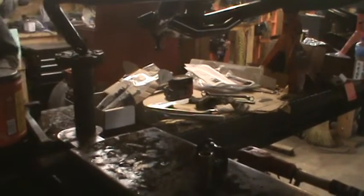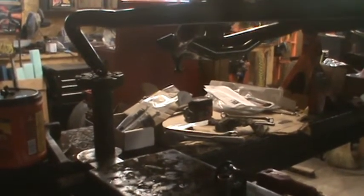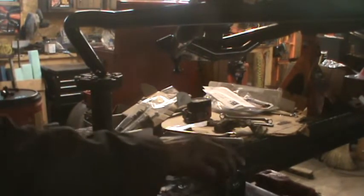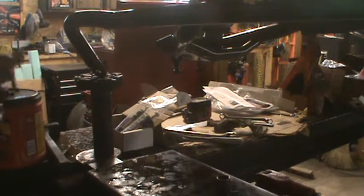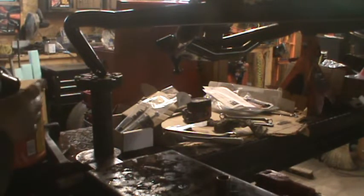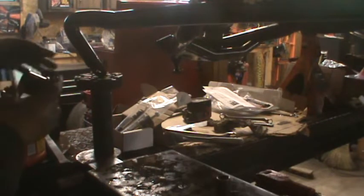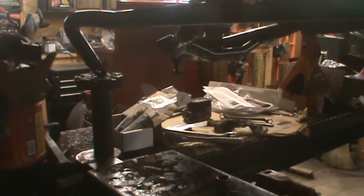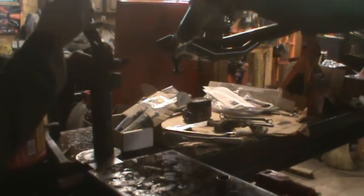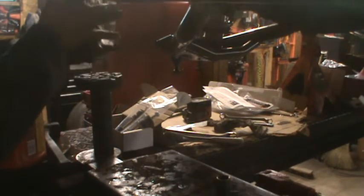So because I have help, I got on a roll and started to install the sway bar with that video on it. So I got one side up a little bit. Slip the rubber thing over the bar first. Yep. There's a lubricant for the inside of the bushing where it meets the sway bar. I just opened it up and slipped it on.